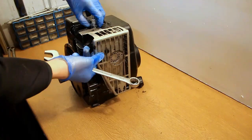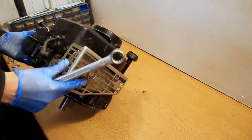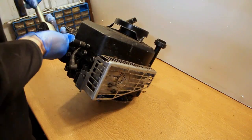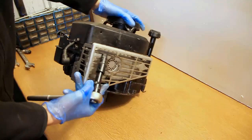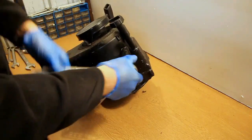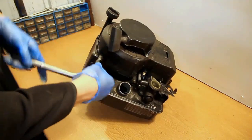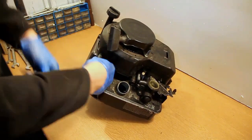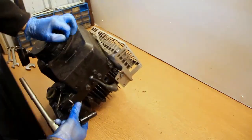This engine is having a rebuild because it has got a bent crankshaft. The reason I know that is because when you pull the cord to turn the engine over, the crankshaft wobbles a bit, and usually that is a sign of it being bent because when you turn it over it doesn't quite turn perfectly. You can tell when you look at it, so what I'm doing is taking it all apart and I'm going to replace the crankshaft.